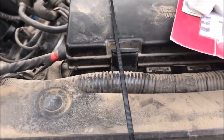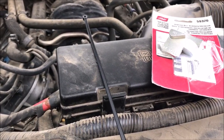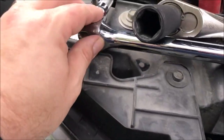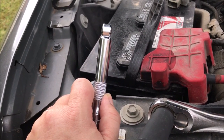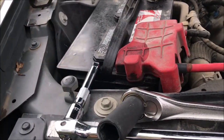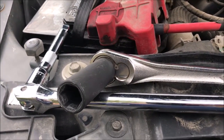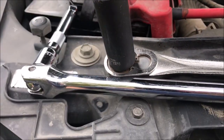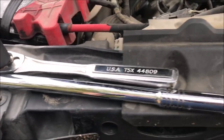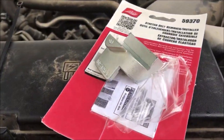I'll show you how that works, and that's actually in the Ford manual. So go figure. The other things you'll need is a breaker bar with a half-inch drive — that's to move the tensioner, to relieve the tension on the belt so you can get it off on the one that isn't a stretch belt. And then you need an 18 millimeter socket to turn the crank to put the stretch belt on. The two belts, you don't need that belt stretcher, so don't spend any money on that. You need a zip tie.